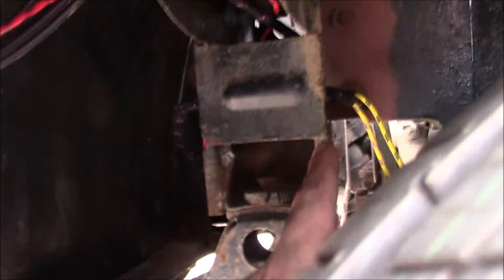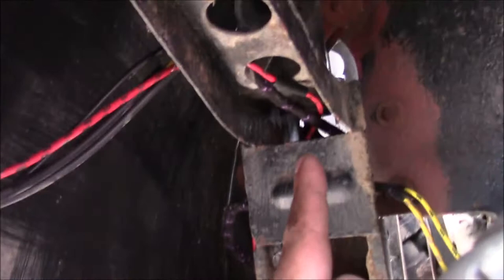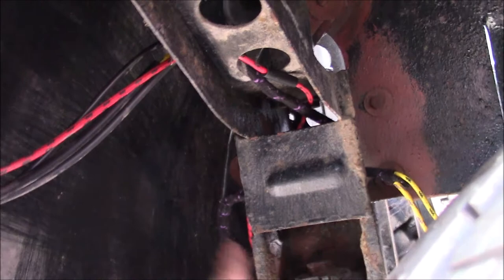In the wheel arch, there's the other side, and it goes through a hole in this bracket here. There's one that side and one that side. So the wiring goes through there, and then you have the branch off for the headlights, which is held up in the wing support. That there is a wire clamp, which I'll do when I've got the headlights off and ready to be wired. And then that wiring runs up there. The thing I haven't got installed yet is the side light wiring — I'm not sure which section that is, so I'll have to dig that out.